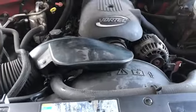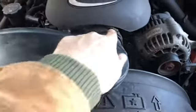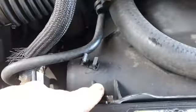Yeah, and one last thing, check your coolant level, because it's probably low on coolant. You know, it's got that little safety drain plug that pretty much when your impeller destroys, it breaks it open, and then your seal, and it shoots out a bunch of coolant. So you're probably low on coolant. Check that. All right, then put your intake on. I still gotta tighten those. You got your fan shroud on. Remember, you have body pin there, body pin there, body two in the same spot there. I can't show you. 10 millimeter, and then 10 millimeter up there, and then your intake.